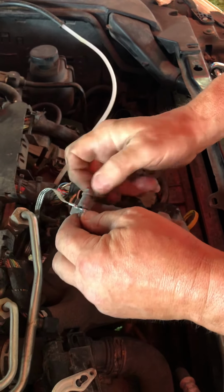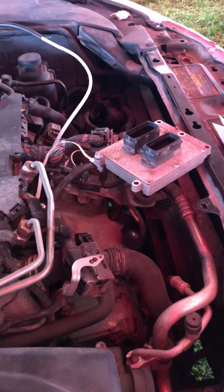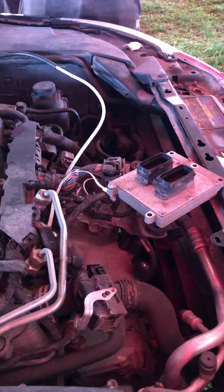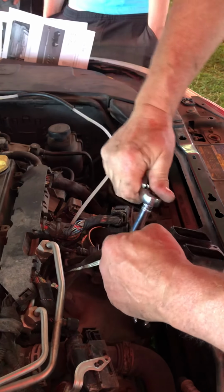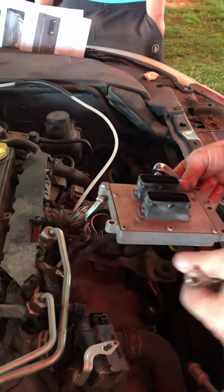Okay, now I need my wrench. Get rid of this extension for the moment. 10 and 10. All the tools and instructions are included. Tighten this again. 16 foot-pounds. Now there's our ground wire, secured with lock nut. And as you can see, I have done it on the top side of the vacuum hose.